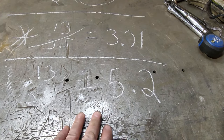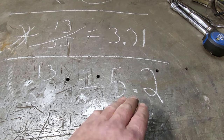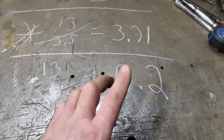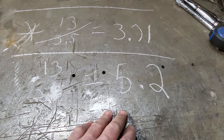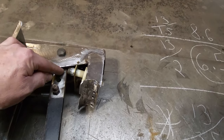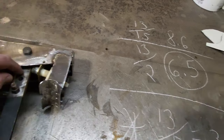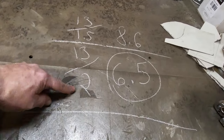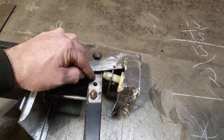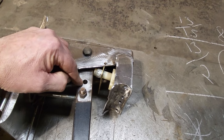After looking at a number of sites now, it just seems like this is an old system, and I think it may have to do with drum brakes, because it's a lot easier. Where everybody's running disc brakes now, everybody's looking to have 6-to-1. So I started playing around with moving the location of this hole up a small bit more, farther up inside this here. This is how I came up with the 2, 6.5. So that'd only be 2 inches down from here, okay? Which is a half inch above this one here, because right now this here is 2.5.